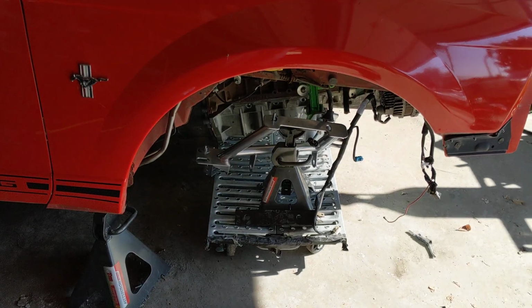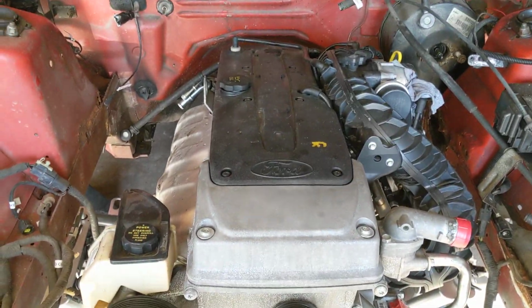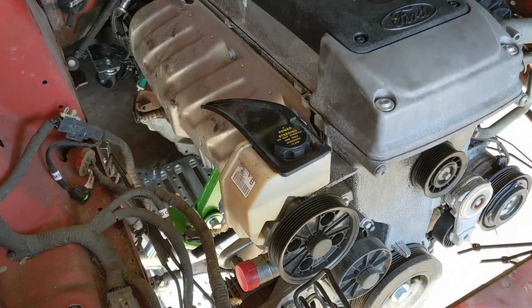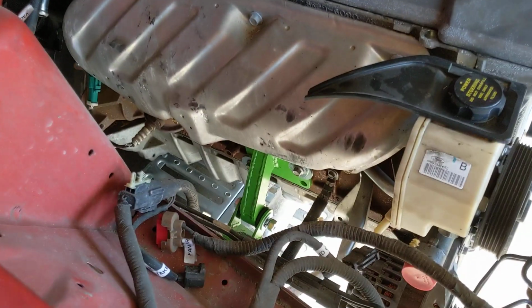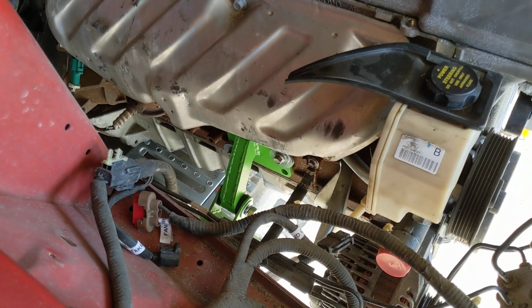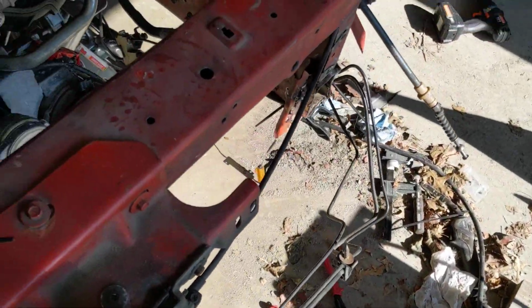It's going to have the front brakes from my neighbor's 2005 Mustang GT. There's a big brake kit to bolt those on. And other than that, a used Barra motor, a used T56, which I'm going to have reconditioned, UPR suspension components. So that's a SN95, 94-95 K-member for a pushrod V8 with Chris Nieves engineered swap motor mounts. I'll get you links to that stuff as soon as they appear. This is like the second pair he made, so they go on my car. Thank you, Chris, by the way.